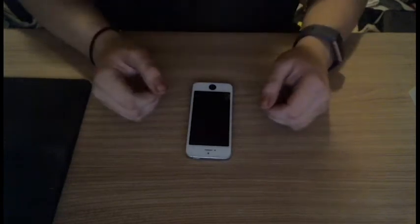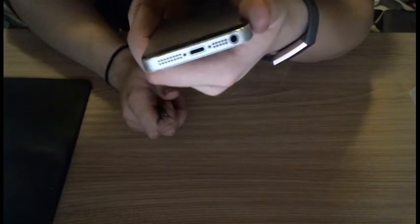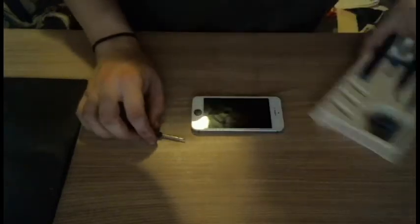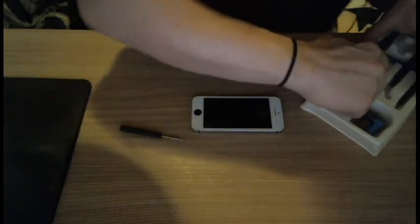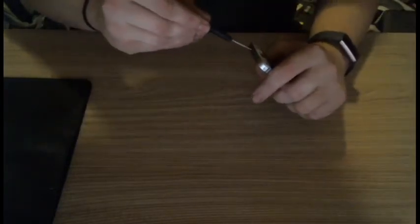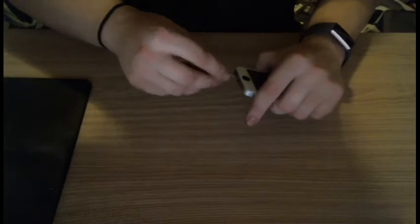So Matt, I've got my guide open on my other monitor here, so I don't know this all by heart, but it's more or less pretty simple. I've got two screws here. Well, in this case, there's only one because I lost the other one, but there's two screws here that you would normally need to use a special proprietary Apple one, which they've given in the kit I've had in the past. And then with the kits, they'll give you regular screwdriver ones that you can replace it with.